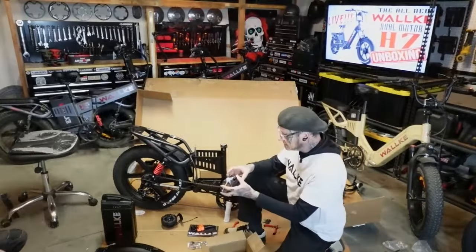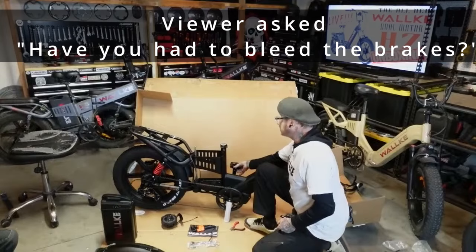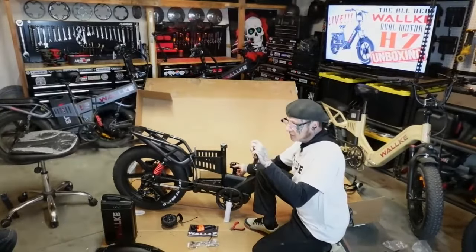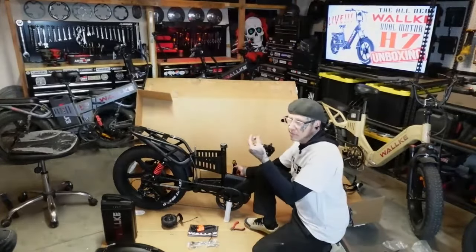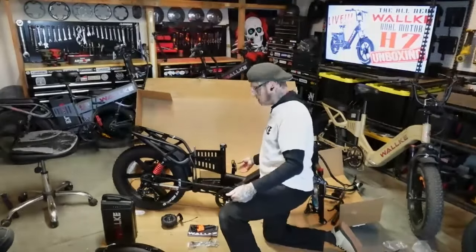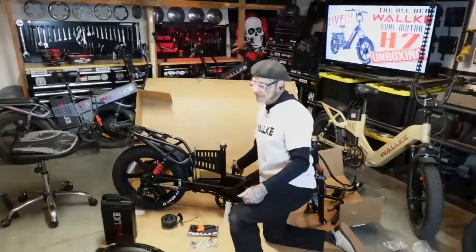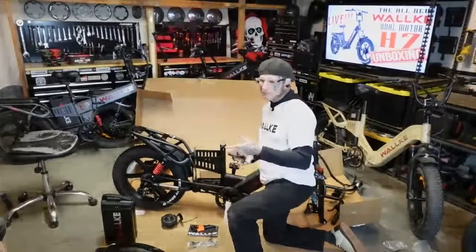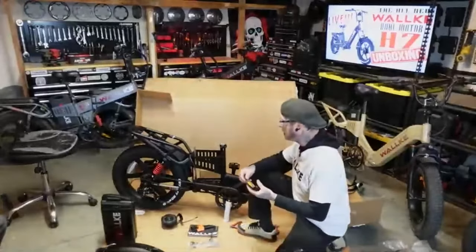These are the typical folding pedals. There is a screw at the top that kind of acts like your master cylinder — once you pop that off you fill it with mineral oil. They actually sell injection kits, but if you just get something like a little baby syringe, fill it with mineral oil, and push it in there — if air bubbles come out, you needed to bleed your brakes. I haven't had any issues so it's a good video idea but I haven't needed to do that yet.